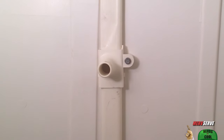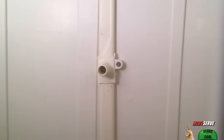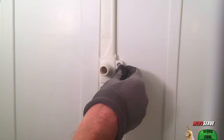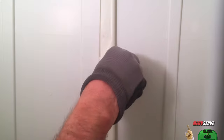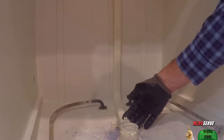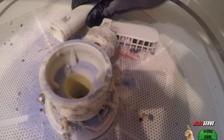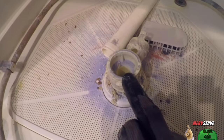It's easy. Next, it's important to loosen this feed line, which is attached to the back of the machine. Not much effort required — I just use a little 6mm socket to loosen it, or you can use a pair of pliers and unscrew it by hand. It needs to be loosened so you can detach it down here. Just move this little tab and she's out, which is going to enable us now to work on this.